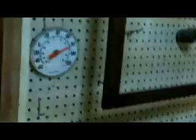It's almost 80. I'm going to run up to the store, to the gas station, and get a pop to drink, and let this flash for about 30, 40 minutes since I've got three coats on it. It's already been about 10 or so minutes. I cleaned the gun and everything, so another half an hour will be good. You just got to watch in the wintertime, even though I've got it up to 80 degrees in here.